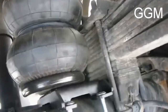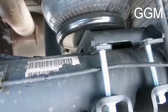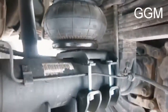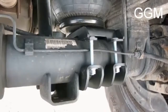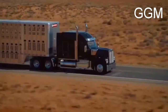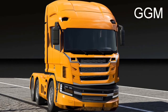You are going to use less air in this convoluted air spring and it will still be able to lift heavy loads compared to the sleeve type. This design allows the air spring to lift heavier loads at lighter air pressure, which improves load distribution. As you can see in our videos, the double convoluted design is more important because it is used in trucks and off-road systems.